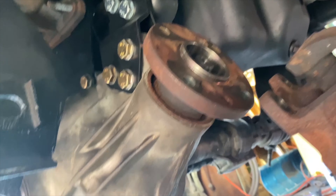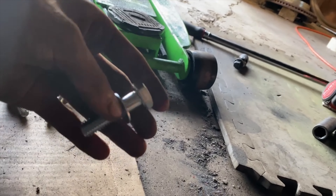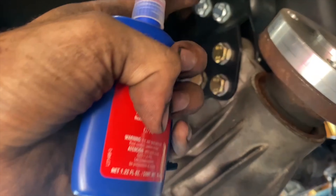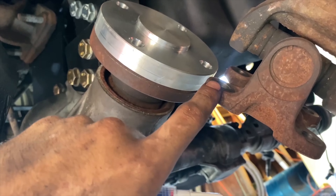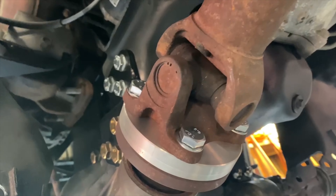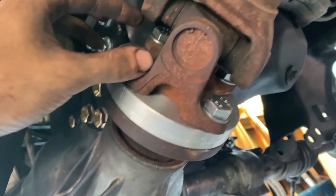I got the new control arms, the springs, the back control arm, the lower control arm, the front strut, and the tie rods front and back, and the sway links. Right here on the diff I'm putting four bolts with washers, and I'm applying thread lock to all the other bolts too so nothing comes loose. I'll apply thread lock, put these in the original slots. Make sure you put it in gear so the diff doesn't spin when you try to torque these down. Put thread lock on these for sure because everything is always moving and you don't want them to vibrate out.